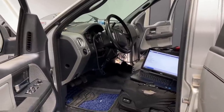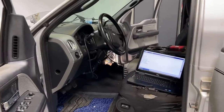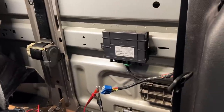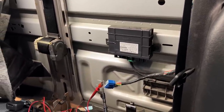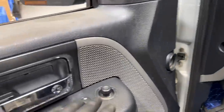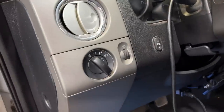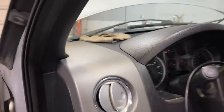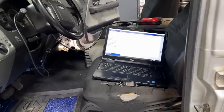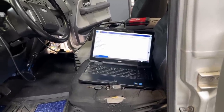This vehicle has a vehicle security module strapped to the back wall on this '04 F-150. That module handles the perimeter alarm, power door locks from your key fobs, automatic headlamps because the sun load sensor comes into it, and your horn for the alarm. And guess what — all those functions, all at once, are gone.